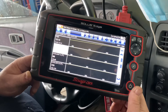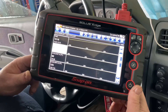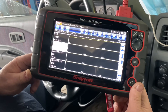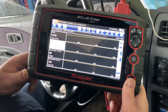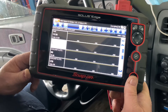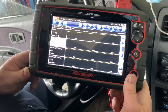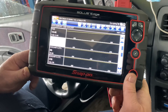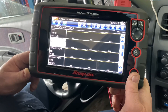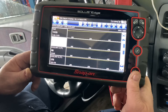We've been running the vehicle for over 13 minutes now. At this point that temperature should have reached the 195-degree mark, but we're only getting up to 174. We're also running this in the shop, which should actually produce even more heat. Out on the road that temperature would probably drop even more with airflow across the radiator. So right now we're going to determine if that thermostat is partially held open, which is allowing too much coolant flow and keeping the coolant temperature down.